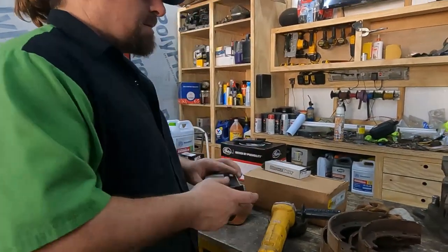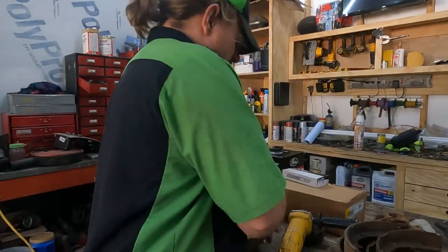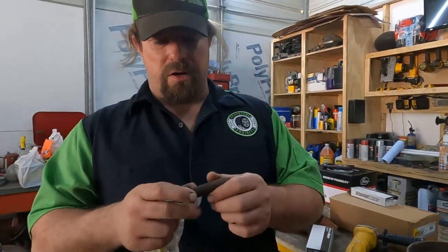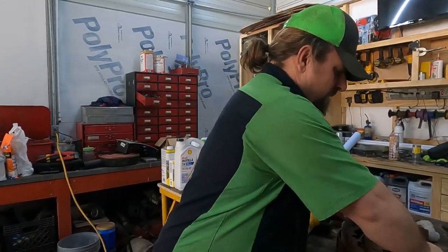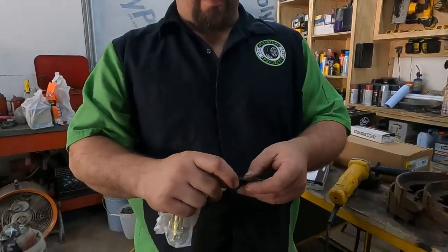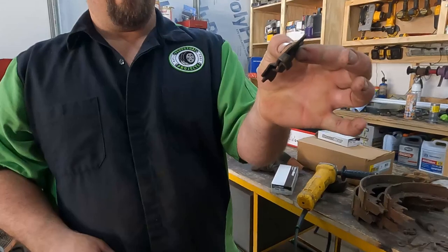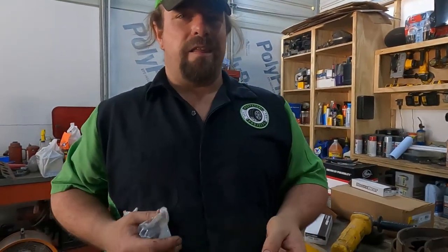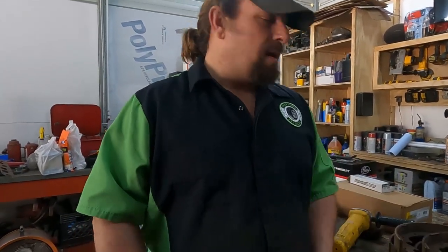We had to order some little $10 kits because obviously one of our adjusters didn't turn. This one works, but I figured out why the shoes were on backwards on the other side. They had two of the adjuster levers for the driver's side. So rather than get the right parts, they just put the other sides on backwards, and the adjusters weren't even gonna work because, well, it was installed wrong and missing pieces.